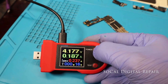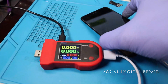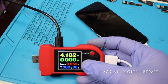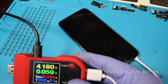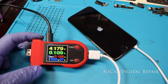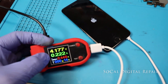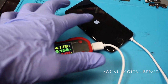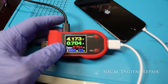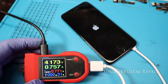Let me attach the screen real quick. Okay, so now I have a screen attached. Let's see what happens — we click power, it's sitting at zero amps, and we click test to turn it on. We should see an Apple logo — there you go. As you noticed, this whole time I didn't have a screen attached. I feel like this number tells you a lot more about the device behavior than having a screen attached. Of course the screen will tell you if it's working, but the numbers don't lie. You can see the numbers are going up higher and higher and we should get a lock screen any second now.